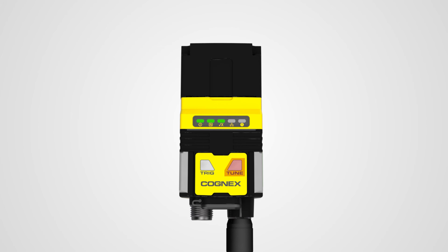After about 20 seconds, the ring lights on the sides of the device will start flashing between green and red, and then you will hear a beep. In the next 10 seconds, press the trigger button once. After the second beep, release the tune button. The device will then perform a factory reset and reboot.